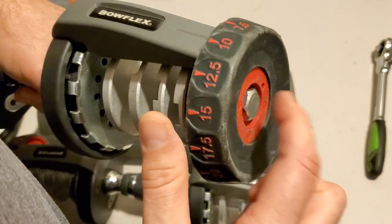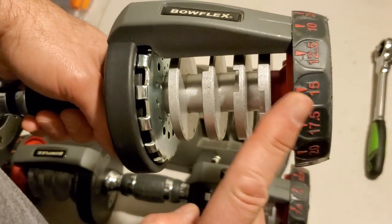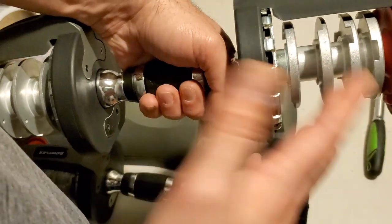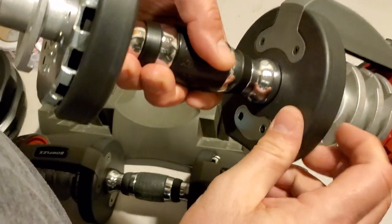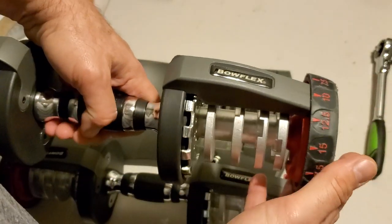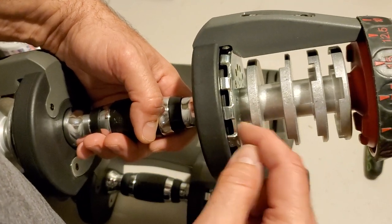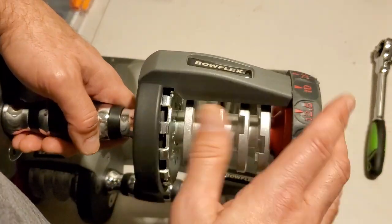It's not because this hasn't been tightened enough — this was tightened plenty, but it's missing something. On this particular set, I took out the washers. I've taken out both, and I've only taken out one, and it happens in both cases because you're basically leaving gaps. So this handle is completely wrong. It needs to be disassembled, and you need to go back through and make sure you didn't put the wrong washers back in, and that it is tight enough.